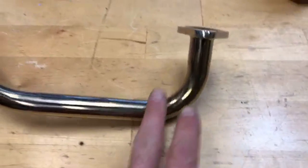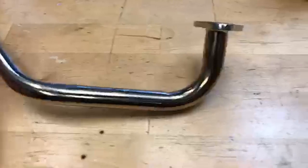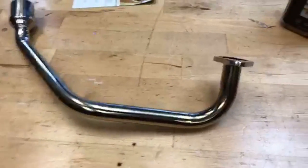Because you want to match the exhaust with the carburetor. So in order to make that work right, I had to go with a 20 millimeter carburetor. The 13 millimeter carburetor wasn't working. So depending on how big your exhaust is, I mean, if you have the stock 50cc or the stock 125, stick with what they recommend. Whatever pipe you're getting, get the smaller one, unless you're going to the big bore head or a bigger intake carburetor. That's what I would recommend. So there are some risks if you go too big. You'll have to match it with a bigger carburetor.